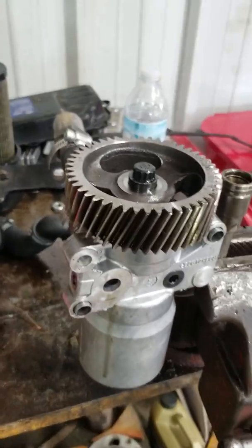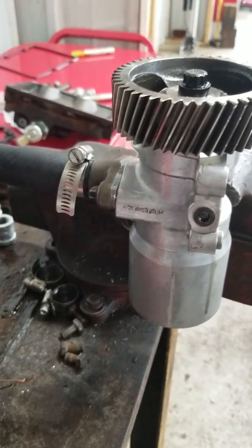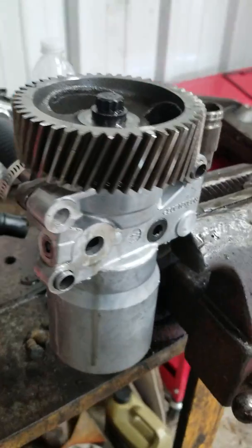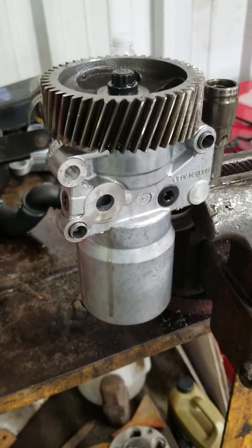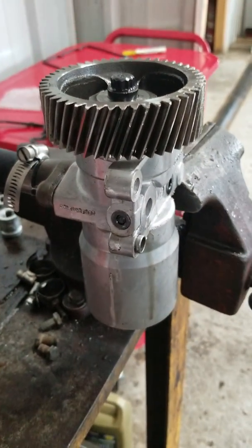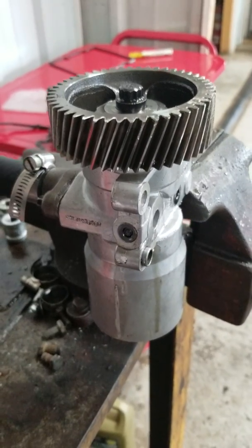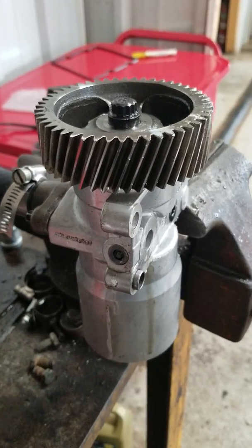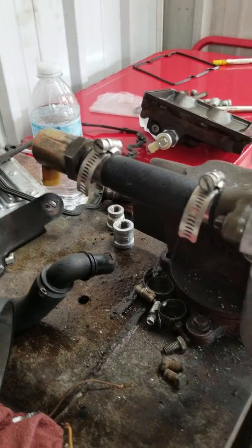The air is gurgling up through the oil filter housing. Nobody's explained this or anything, so this brand new five or six hundred dollar pump I bought — I think it's junk. I can't get any straight answers on any of the forums about this. Everything relates to the cast iron pump and not the old-style round pump in the 2003s and 2004s, so I'm thinking it's bad. We're not even worried about the IPR — we just want to see why we're losing air pressure.